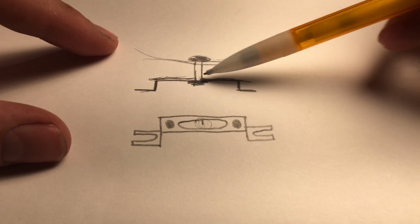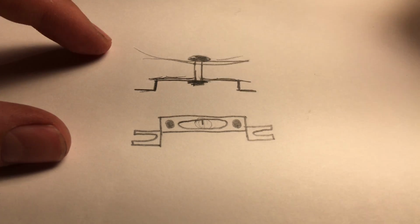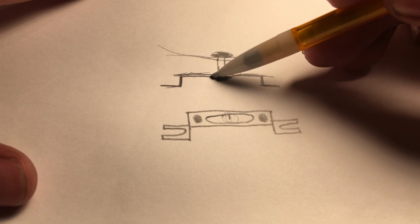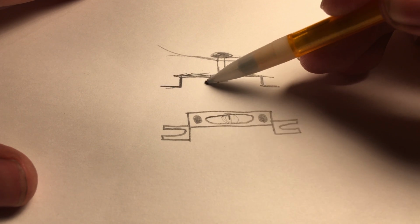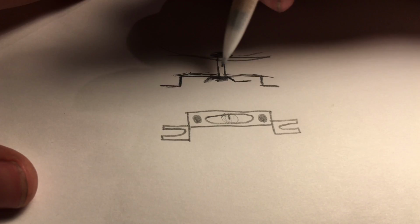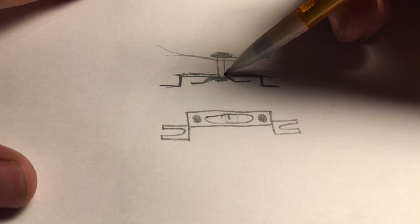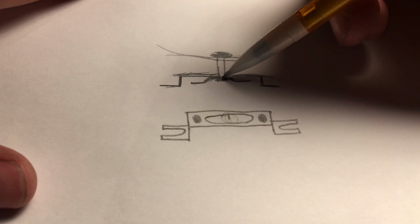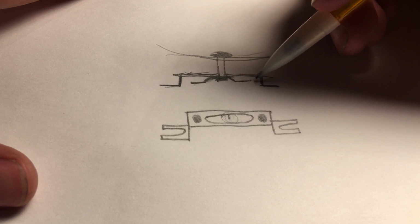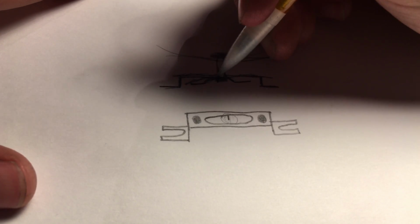So it's not flat. The undertail isn't flat, so you need to bend this to make it work. If you want it to work, you're going to have to bend this part down, like this. So basically you want it to look like that. It has a little spot that bends up so it can reach into the undertail, so the bolt can reach through and catch here, and then the rest of your bracket is free and not getting stuck up against the undertail, because the undertail is shaped kind of like this.